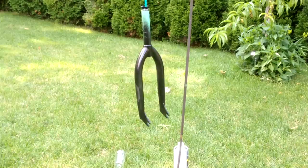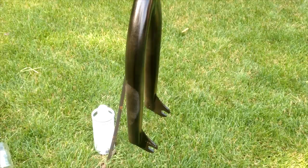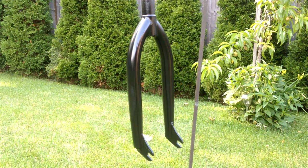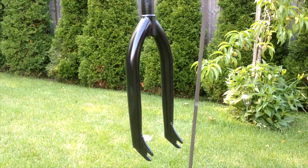That's pretty much my first coat — as you can see it's really light and there are still some minor imperfections, but that's alright because it's only the first coat. I just dusted it lightly so it won't drip and so the paint sticks on later after the second and third coat. Right now we're going for the third coat and we're looking to get around 100% coverage, but if you don't have full coverage you can always do a fourth or fifth coat.